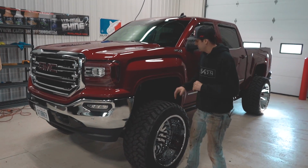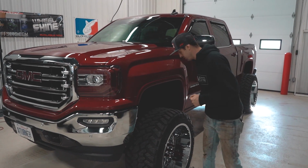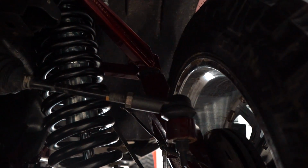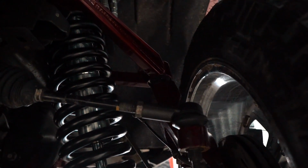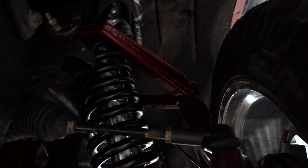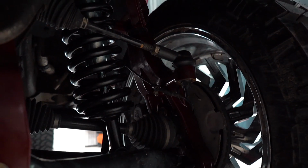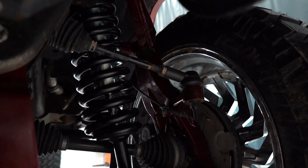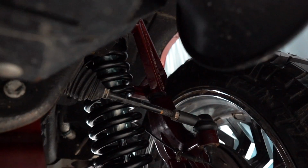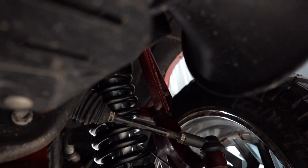So as we dive in here, anything that's red obviously is going to be new. So the McGaughys lift knuckle, upper control arm here, you'll see great angle on the upper control arm. Same as the CV axle shaft. So even with that 9-inch Cognito strut in there, everything is still nice and flat at good operating angles. You see the new McGaughys supplied tie rod end in there, as well as the sway bar drop and the front and rear cross members.